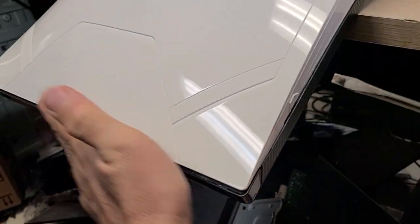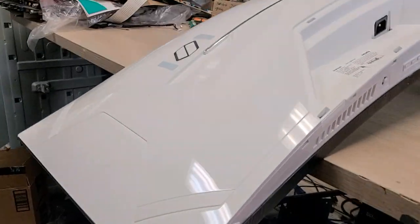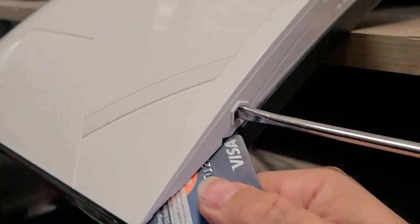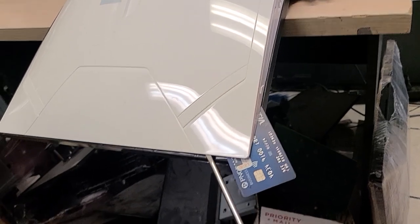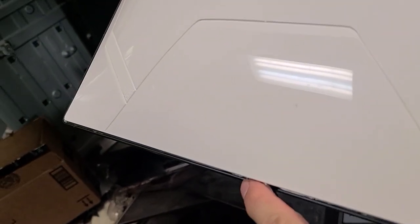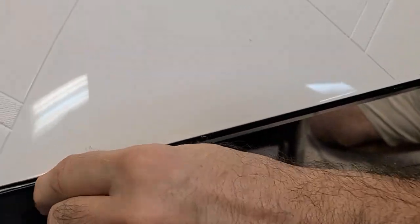Now the snaps on both sides and on top are plastic. The snap at the top is done with a wire. After you do the side and raise it up — it will make a snap sound when it locks. So I'm going to show how that opens. I insert very carefully here, just enough for the tool to go in. The wire goes somewhere in here. They sell special tools for opening those, but for me one large screwdriver is enough. You just move it sideways nicely and firmly. When it starts getting hard, that means it's close to the point where it's locked, and this is where you give it a little push. Corners are a little tricky. Once it unlocks there, this whole long side is open.